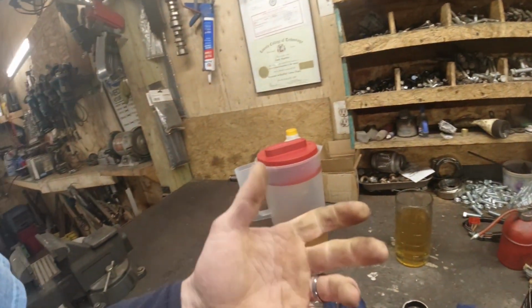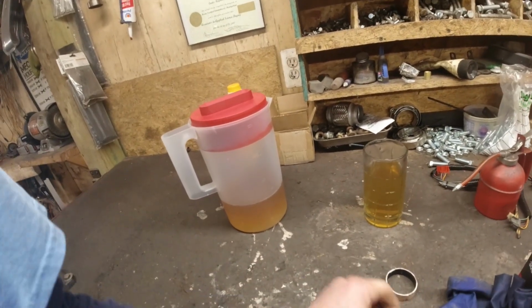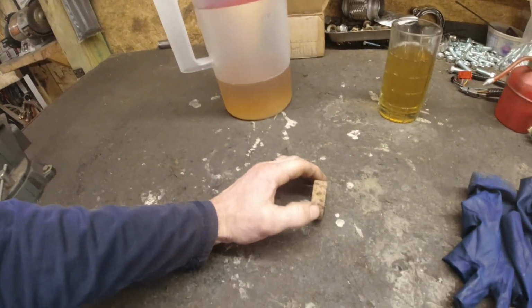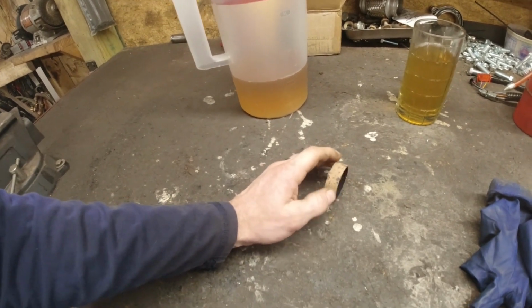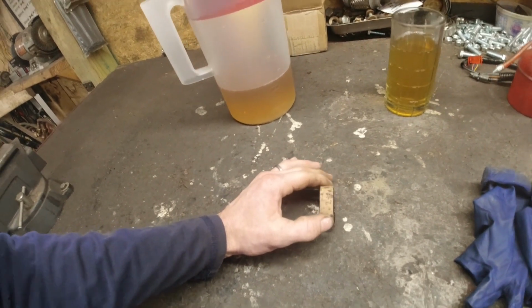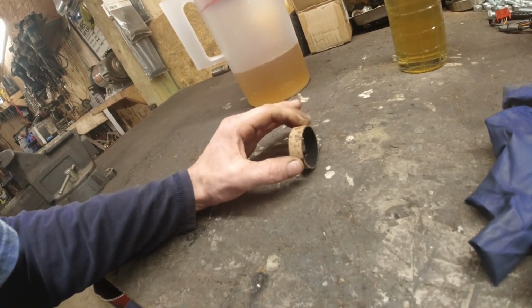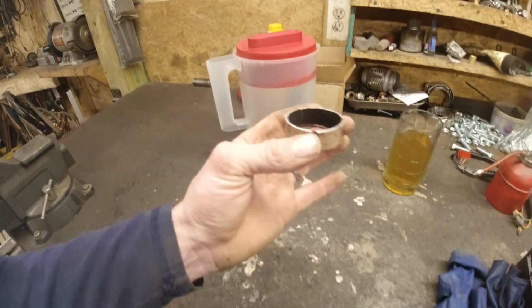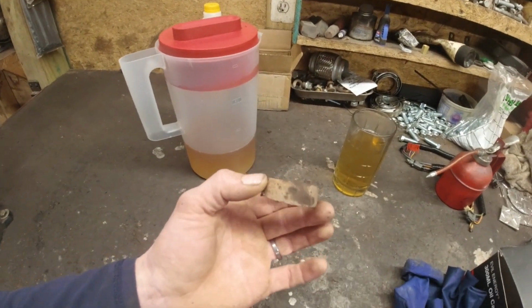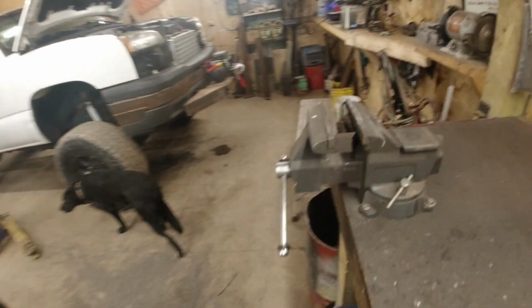I showed that you could adjust that throwout bearing. It was just threaded. So behind the threaded part, I cut this spacer that was about half of that thing's adjustability, and then I put it back in, and then I took some measurements from there and was able to get it set just how I needed it, and then I had to adjust it out a little bit further, and then I got it working. So let me show you that here real quick.